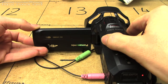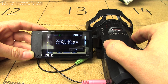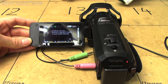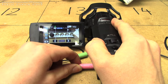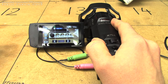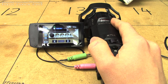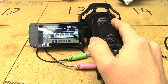If we flick it back around, we'll find it's quite helpful in telling us that an external microphone will partially obstruct image in wide zoom position — that's in case we use the included shoe adapter. Once you've seen this once, you become familiar with it, so go away. This screen will pop up every single time you plug in a microphone and you cannot disable it, which I find to be incredibly frustrating. The only way to get around it is to have the microphone pre-plugged in when you power on the camera.